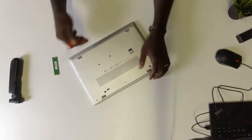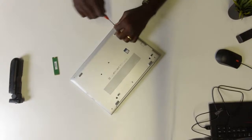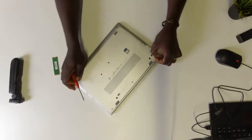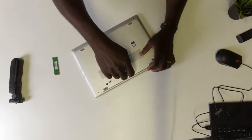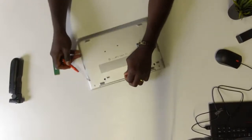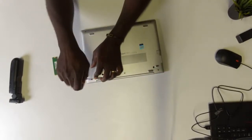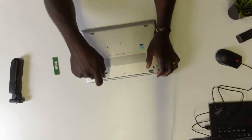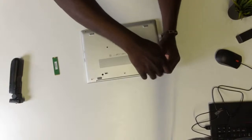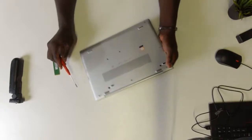I have the second screw out. I've actually covered a kind of review of this laptop on my YouTube channel, so if you're not subscribed, go ahead and do that. I have the fifth screw and that's the sixth screw holding the back panel of this laptop. But if you look carefully there are also two screws right here — do not forget to open them, otherwise you're going to be fighting with taking out the back cover and wondering why it's not opening.